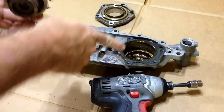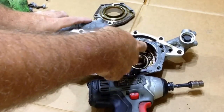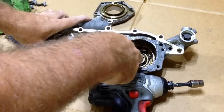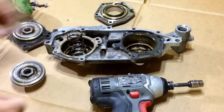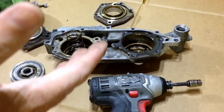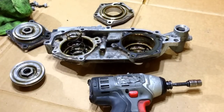I like to take a piece of Brillo pad and clean out the inside where the pistons hit. Take some carburetor cleaner first, then Brillo and scuff it up really nice so it seats well. The reassembly is the exact same as disassembly. Super easy. That's it — thank you very much.